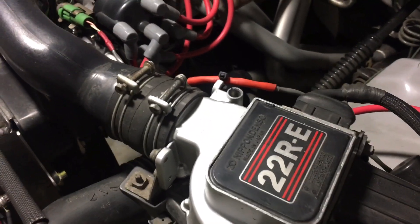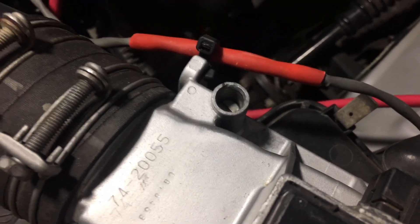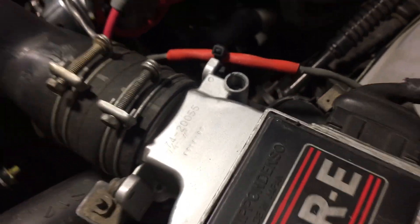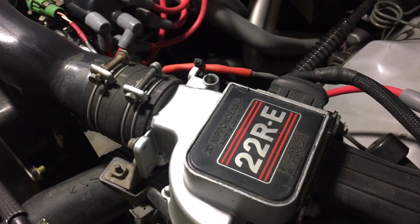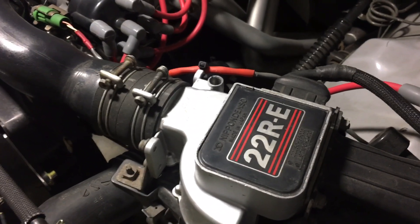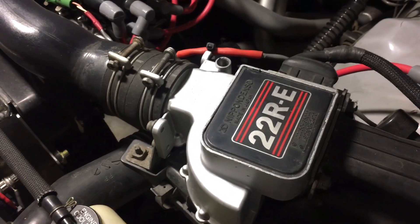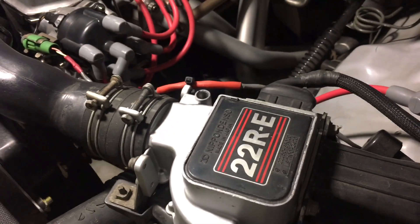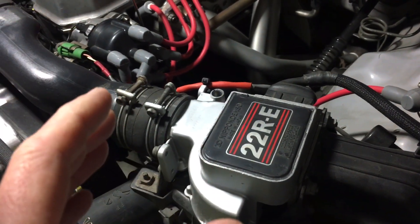You can think in terms of that number Toyota stamps on the housing. If you have a number — say 3.1 for example — that would mean they want the depth to start at 13.1 millimeters. In the TCCS manual they give an example of 2.6 or 26 on the housing, which equates to about a 12.5 millimeter depth. So if you have a caliper or some means to measure accurately, a depth of 12.5 millimeters from that little upper ledge to the screw is probably a fair starting point.